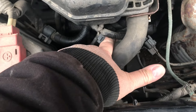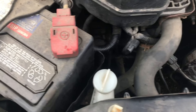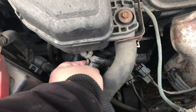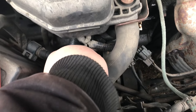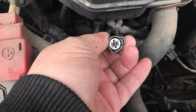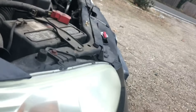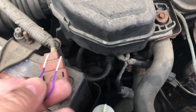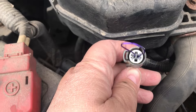There's a coolant sensor switch — this gray thing right here. To test it, squeeze the little tab and pull off the plug. Inside the plug you'll see two pins. You want to jump the pins by taking a paper clip — if you have colored paper clips, peel back the plastic coating — then take the paper clip and plug it in, jumping from one pin to the other.